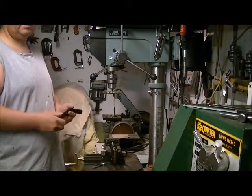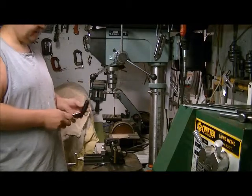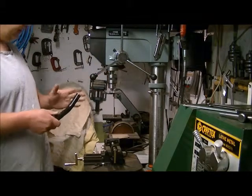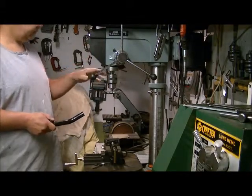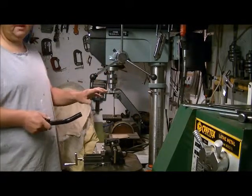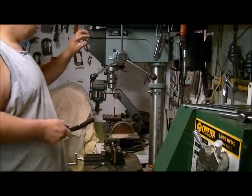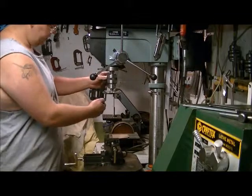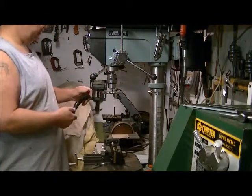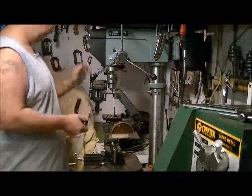You can do just about any kind of design. You're probably going to want stencils for some of this, or some fancy taping with green painter's tape. You're going to need a drill press, which is the best way to do this. Put it on its highest speed, or at least the highest speed your brush can handle. Then fire this up and go into this gently. You're not going to dig or gouge, because you don't want to mess up the metal. You just want to strip the old stuff off and get the rust out of the way too.